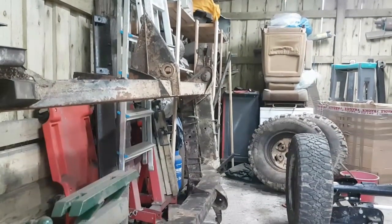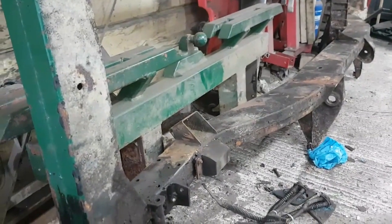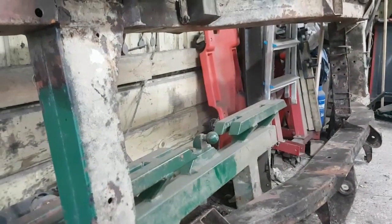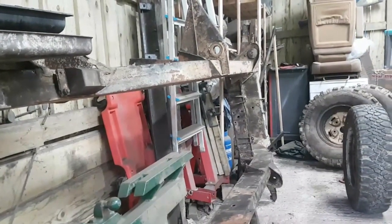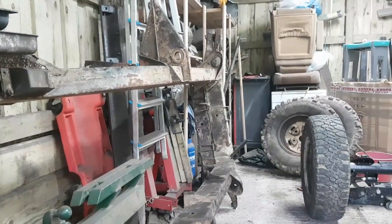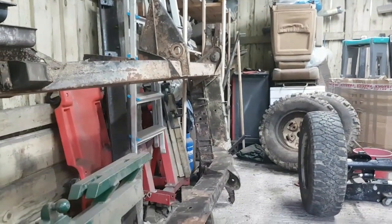And obviously the bulkhead will flex backwards and forwards. So all I'll do with that is fit the front wings, front inner wings. I've got some used old stock, very good front inner wings, which are going to go onto this project. So I'll fit those onto the front of the chassis. I will fit the bulkhead onto the front of the chassis, check alignments and verticals and so forth, because if this thing's flat on the floor, I should be able to check alignment, and then get the bulkhead finished and done. Moving forwards.